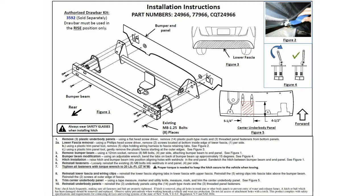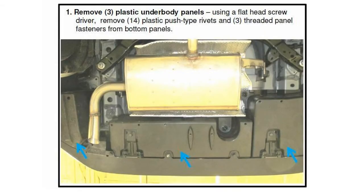I did not have to do this in my installation — it went well. I was able to install it without having to bend it, but the manufacturer does recommend you make that bend. You will have to remove these three panels from the bottom rear of the bumper, and there's also a fascia trim on the rear that you will have to remove, or at least partially remove, as I did.